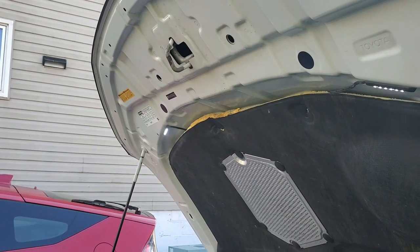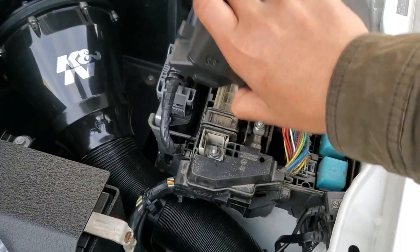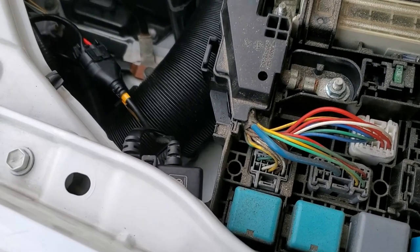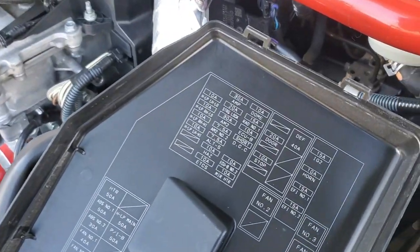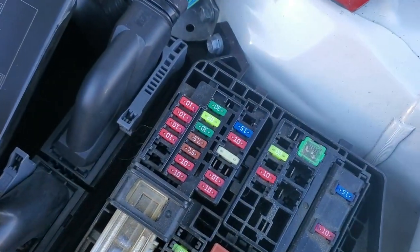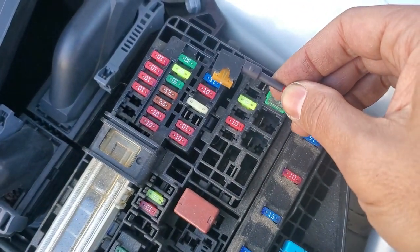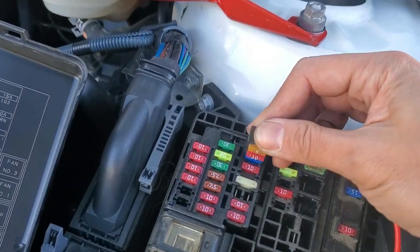Let's do a quick test. For power, I'm going to use a mini fuse tap and run the wire into the engine bay fuse box. It's a little tricky, but you should be able to push the wire in through here and then fidget with it until it pops out the top. I'm going to crimp my fuse tap onto the wire once I figure out which fuse I'm going to tap into. The dome light looks good — it's this one right here. I'm going to use the fuse removal tool because it's going to make popping it out much easier. Now this side is the live power end and this side is the fused end, so the fuse tap is going to install in this direction. The dome light fuse goes on the bottom and the new hood lights fuse goes on top. It's going to plug in just like this.